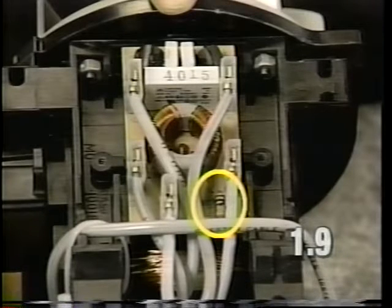It is important to the safety of the machine that these two resistors are not replaced or altered. If there is any indication that the resistors have been damaged or overheated, the board should be replaced and the unit should be retested. Australian motors may use a 5-wire EMI circuit board assembly, but with no coils or capacitors. It will contain the two resistors for static resistance.